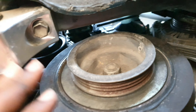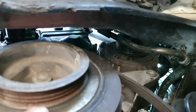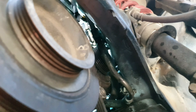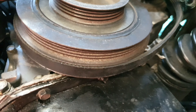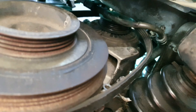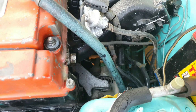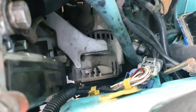We get the belt over between these two pulley wheels here. To get it over the alternator, you basically just twist it a little so it can go through that small tight space. The belt is on now — make sure it is over this side, the last end to the motor, and there it is on the pulley wheel.